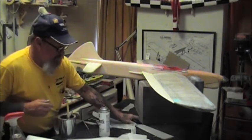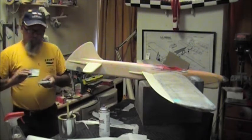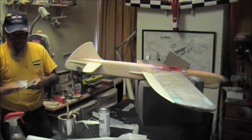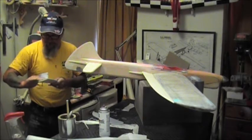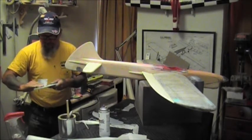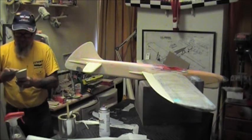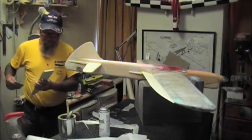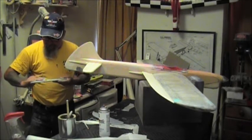It doesn't feel oily. This is the second one we did - let's sand it out for the second coat. I use 3M wet and dry paper for this, 320. You don't need to use 600 - leave it some tooth to bite from coat to coat. I'll go ahead and post this up on the internet before I go take the drive to Wix today, and let's see what kind of response I get on the DC 540. I know a lot of people are starting to switch to it.